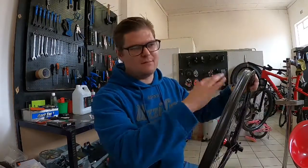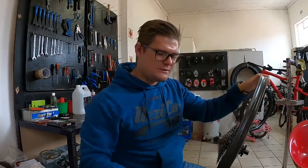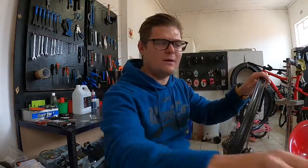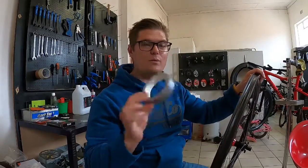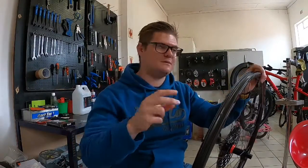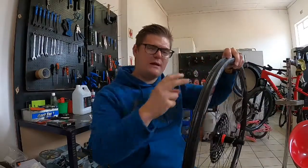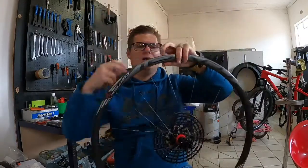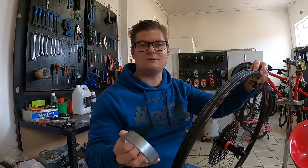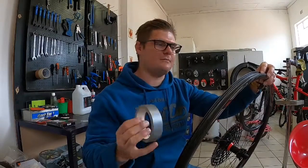Put the lubricating spray into every hole, then make sure you clean the surface of your rim. I used some brake parts cleaner and paper towel to make sure the surface is nice and clean before sticking the insulation tape. I've worked it into all the corners with no bubbles. Now I'm going to take the duct tape — they're calling it tubeless tape these days — go around two times past your starting point, and always start opposite to your valve hole. I'll show you the best tips for putting your tire on without pushing the tape off the rim.